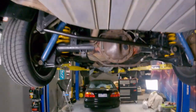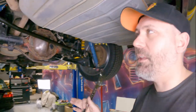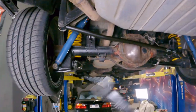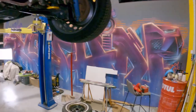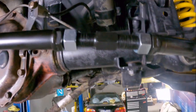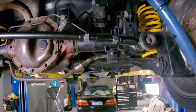The bar is fully installed. One thing to note when tightening up rubber bushes - make sure you tighten them with the load of the vehicle weight and at ride height. If you tighten it up and then put the weight of the car on it, that will twist and cause the bush to prematurely wear and flog out real quick. Because I don't have a four-poster hoist, what I did was get the old wheels, put them under there, put the whole weight of the vehicle on there so it sat at ride height, and then tightened up all the bolts and nuts. This is not a wheel alignment - this is just the installation process. What you should be doing is taking it to get professionally wheel aligned.